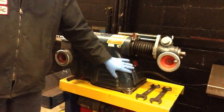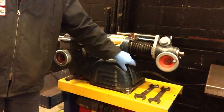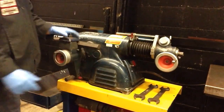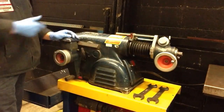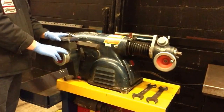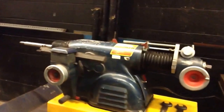Here's your power switch right down here — this turns the lathe on and off. Next, we're going to have our horizontal feed handle. This is one that we're going to use during the machining process of the brake drum. And we have our cross-feed handle as well. Let's go ahead and set up a drum to show you what that looks like.